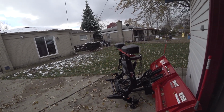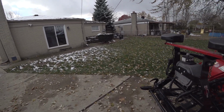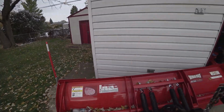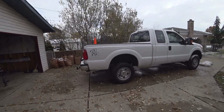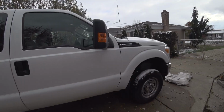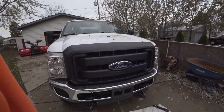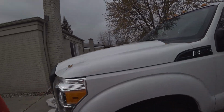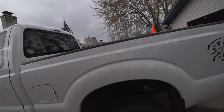But you can generally do it with the Super Duty F250 or F350, just because once you get that plow prep package, you get heavier front springs, and you're going to get that Dana 60, I believe, on every 250 with four-wheel drive. So just adding four-wheel drive gives you an incredible amount of front axle carrying ability by default, but then adding the snowplow prep package gives you heavier front springs, which in turn gives you the proper amount of weight carrying ability on the front axle.